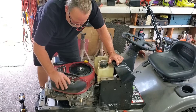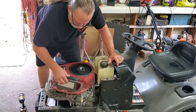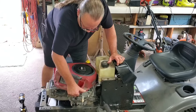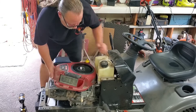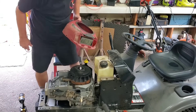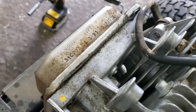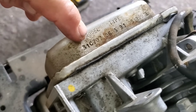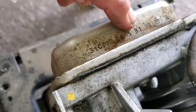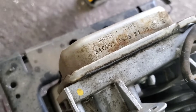This one might have a screw down here — some of them have a screw. Nope, doesn't have a screw. There's an O-ring right there that kind of holds it up there. Engine cover off. So in order to look up the correct carburetor or any parts for this engine, you'll need these numbers right here — put them into somewhere like Parts Tree and then look up your numbers.